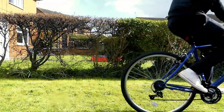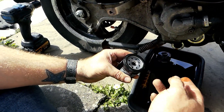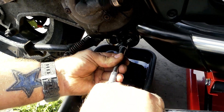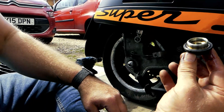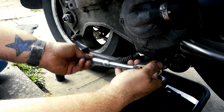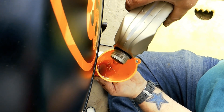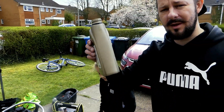You can do this at home — don't take it to the dealers, they'll charge you £300. On the oil filter, seal it with oil on the rubber, don't overdo it. Refit the drain cap with a 24mm socket. We'll fill a full litre, then measure out 300 millilitres to make up the 1.3 litres — spot on.